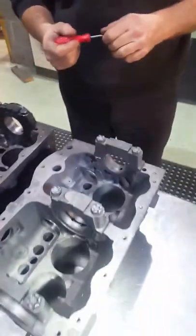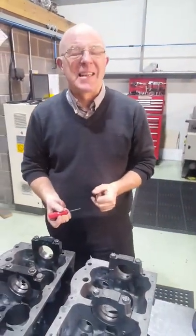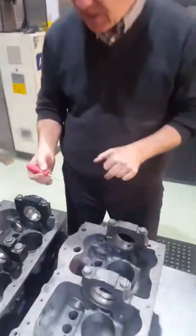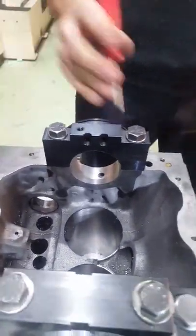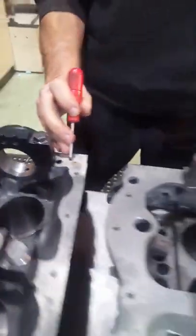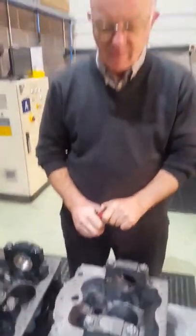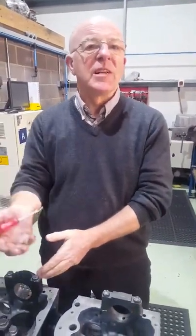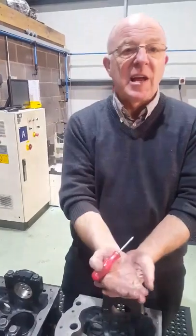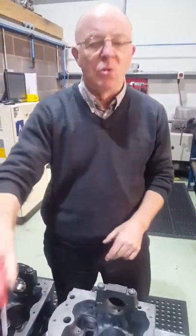The biggest difference on the sump face is the midget has a screw-in oil pickup pipe. The mini has a plain hole because it has an O-ring and the gearbox clamped down over the top. But you can drill that out and tap it to make it the same. It's a larger hole on the inline, as you can see. This one's also got one extra hole here and another extra hole here to hold the sump down. On the mini, we do a conversion for a 5/16th sump gasket, but that's an absolute waste of time on an inline because you've got no pressure on the sump — there's no gearbox under it. On the midget it's just a sump, so no need.